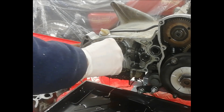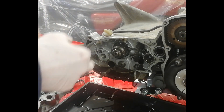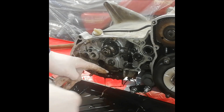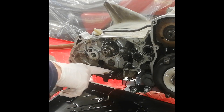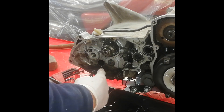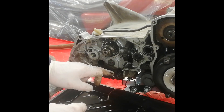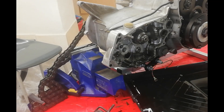This is the nut I need to undo — the nut on the end of the gearbox main shaft. What I'll be doing is re-locking the gearbox sprocket like we did before with the chain and the vice, and then I can undo that nut. That's really thick, really gooey — never seen oil like that before. Maybe there's water in there, but I think it's also a mixture with grease.